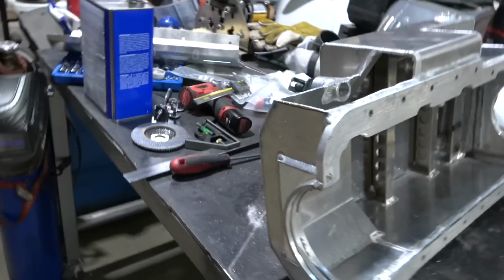Alright, so you guys saw, I just cut it apart. I got the portaband blade stuck for a second. I had to do some relief cuts. Any time you cut metal that's been pulled together and welded and everything flexes and draws, then the material can get to where whenever you start to cut relief cuts in it, it just sucks together, and that's what happened. So I got it cut,